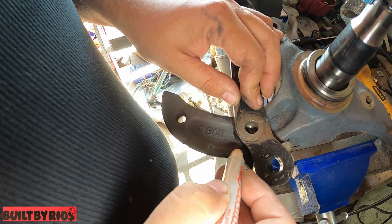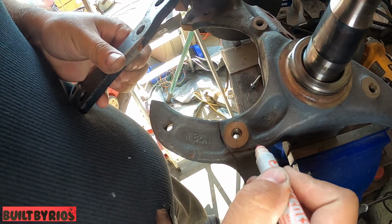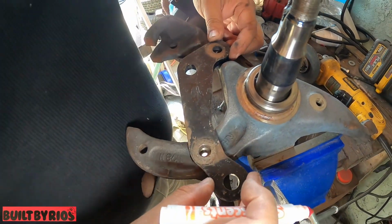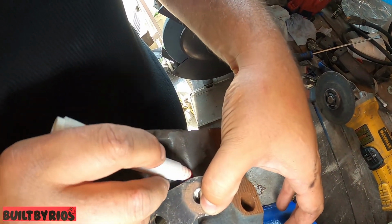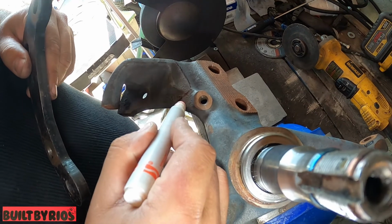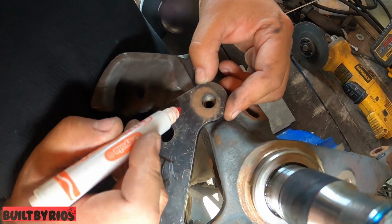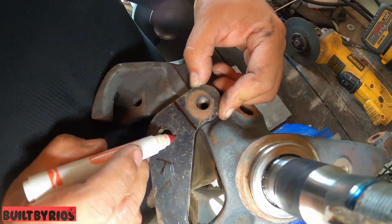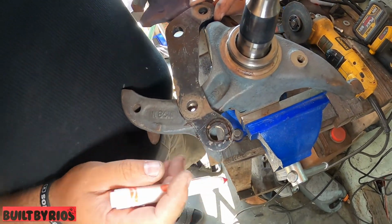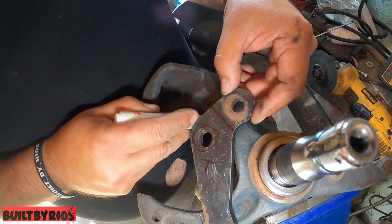So let's sit here and here, so we don't try to bring it in like that. Okay, we're going to slice and slice. That's for the bottom, not for the top. We're going to go up to here. We're going to try to bring it down too, because I don't know how much clearance we need for the bolt. This is where the bolt goes for the caliper. Same thing here, the bolt goes for the caliper, but from the backside. So you need clearance, so we're probably just going to go straight down right there, like that. Start the cutting.